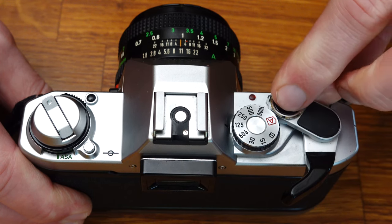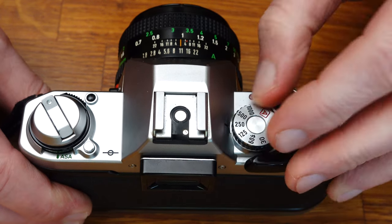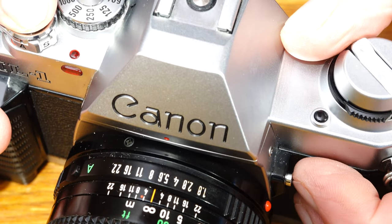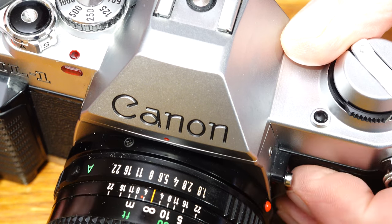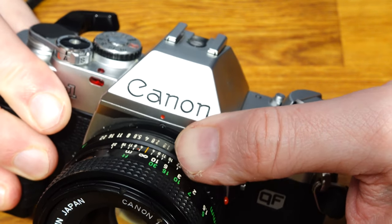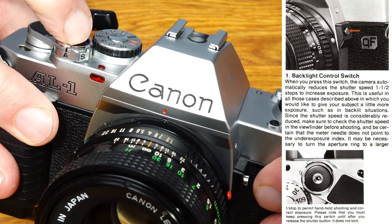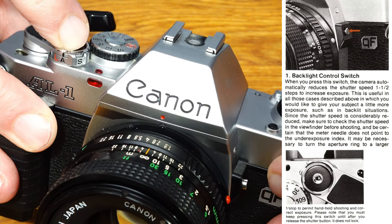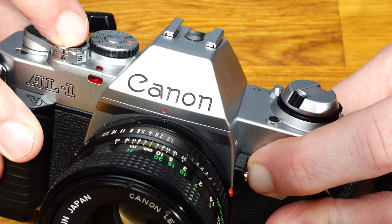The same is true in backlit situations, where automatic metering would include too much brightness and the main subject would be underexposed. Another option is to use the exposure compensation button: press the shutter button as usual, then press and hold the exposure compensation button until the image is captured — the camera exposes 1.5 f-stops more. Keep an eye on the meter needle in the viewfinder to make sure it does not fall into the underexposure range. Note that the backlight button must be held down until the shutter release is pressed; it does not lock.